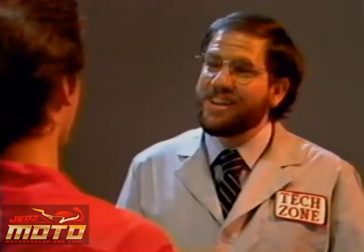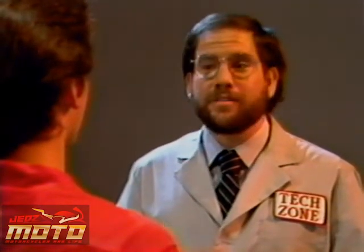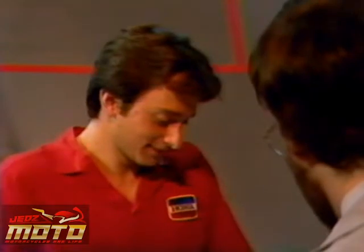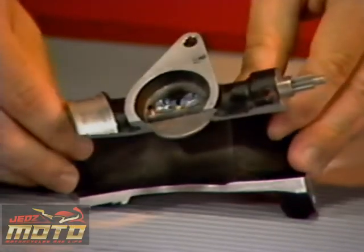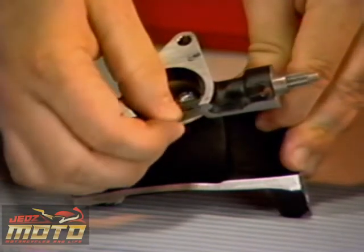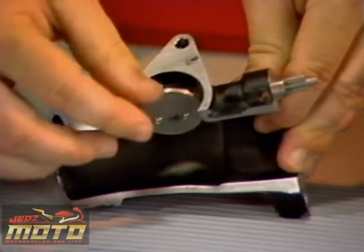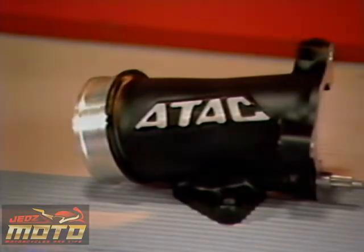Hey, I bet that's where the saying "on the pipe" started. Right, this increased efficiency in the power band is really obvious in some models. The effect is softened by optimizing the port timing, crankcase volume, carburetor, airbox size, or ignition timing. And on some Hondas, the automatic torque amplification chamber, or ATAC for short, simply varies the volume of the head pipe for high efficiency within a wider RPM range.